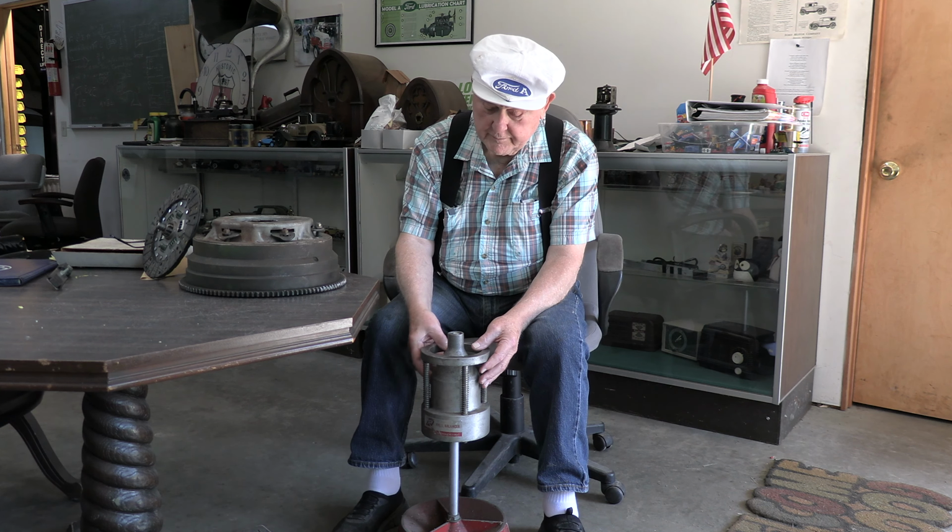And when they push these levers in, that opens up your clutch pressure plate away from the flywheel so that the clutch disc can slip then. So since we want to move 0.6 of an inch through, we actually want to start 0.3 of an inch above level and go to 0.3 of an inch below level. So we want to calculate then the exact position of these, and we're going to calculate it from this surface so we can put our arm across this surface.